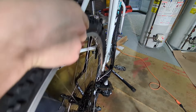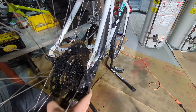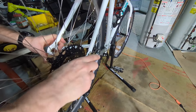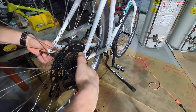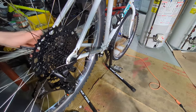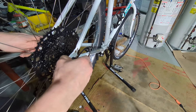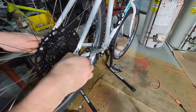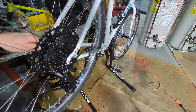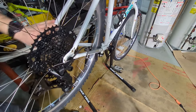Let's get the back wheel on. I've got to go around the U-brake and get the derailleur past. The U-brake with this big tire is keeping me from pushing the wheel forward enough, but there we go. The wheel went in perfectly as far as the dropout spacing - I did spread the dropout to 135mm, this is a 135mm hub, and it went in beautifully. I'll do up the quick release now.